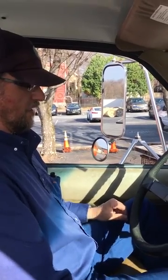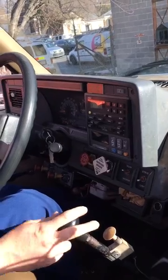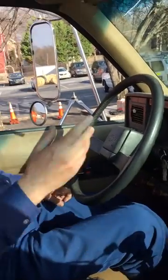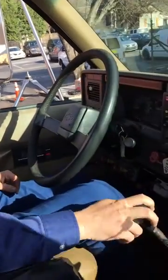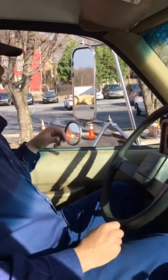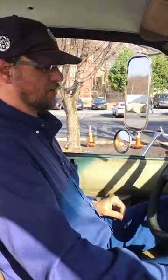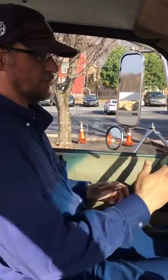When I crank the truck back up, I'm going to push the clutch in and wiggle the gear shifter — that's a safe start. You've got to verbalize it; tell them you're going to do a safe start. You can see out of the corner of your eye, and you want them to be watching. Crank the truck up, then slowly let the clutch out while wiggling the gear shifter. While you're building air pressure back up, hop out, put your chocks back, and do a pull test — put the truck in first gear and let the clutch out a little just to make sure the brakes hold the vehicle.